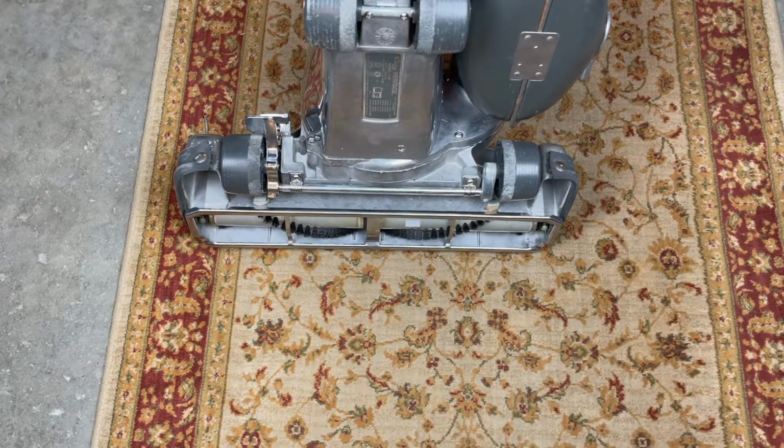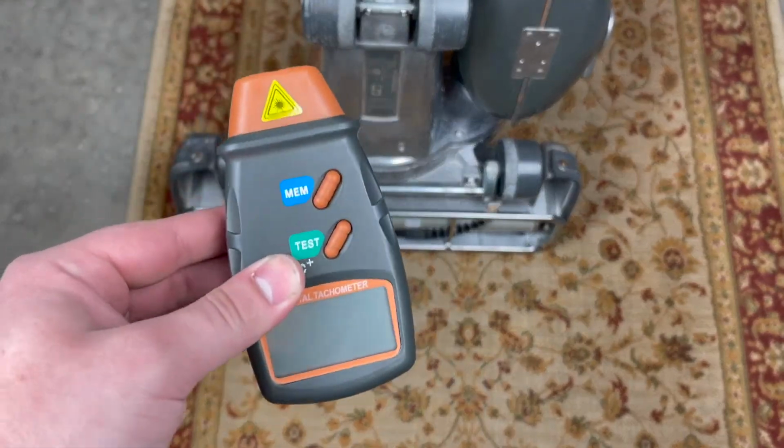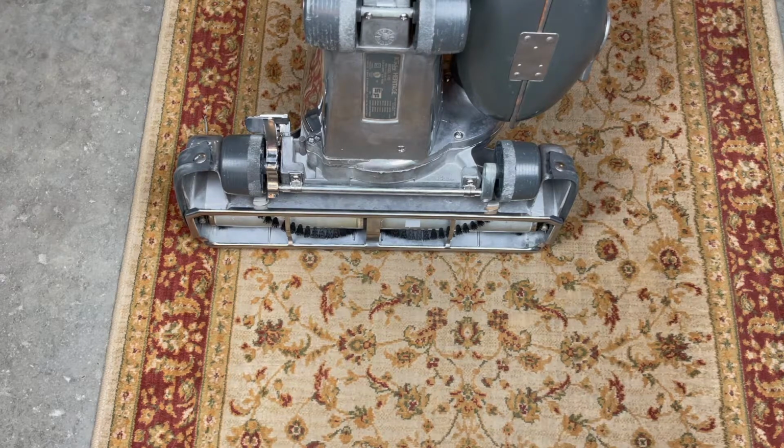So it almost was still warming up there, but 3570 is about the peak of what I saw. And I did do some pre-testing, and 3570 is about what it maxed out at. So obviously nowhere near what my Avalier 2 got, but they have increased the Brushroll speed significantly since this generation of machines. But about 3570 for our Brushroll speed measurement.